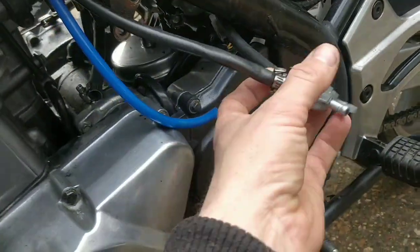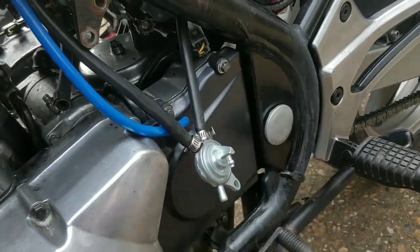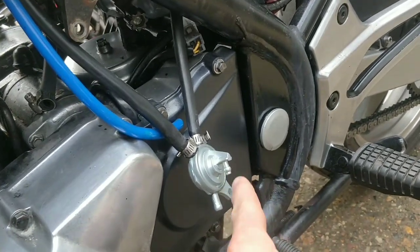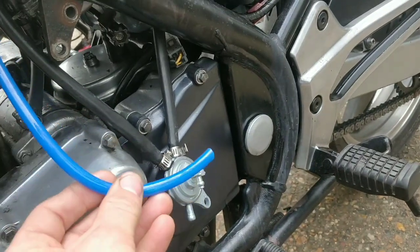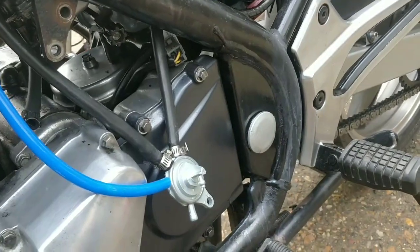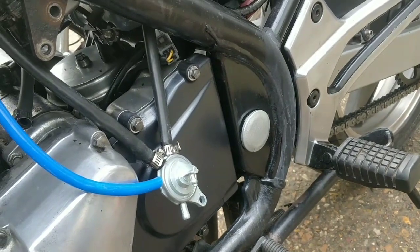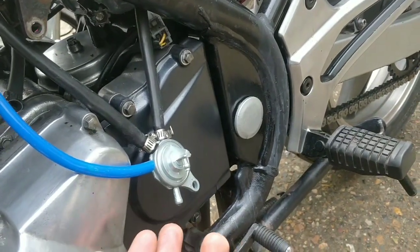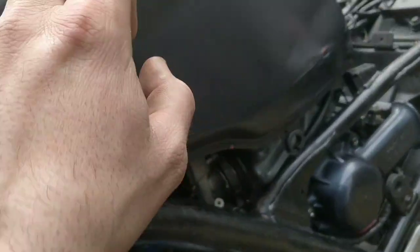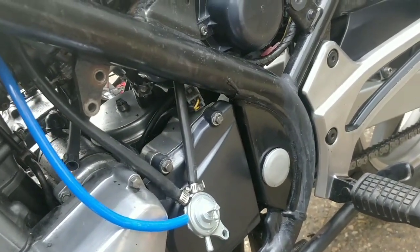This tap, this is a suction tap, okay? It wasn't suction, so I didn't test it. I just connected it all up because it came out the pack. It was free flowing, guys. So it's an absolute lie that it's suction anyway. It was free flowing. So annoying. That actually cost me 20 quid in oil, just because it's cheap Chinese crap, and that's what they do. I mean, listen, this little cheap £8 thing would have been great if it just did have a suction and it did need the suction to work. But if I put fuel in this tank right now, that is free flowing. It is not using suction.